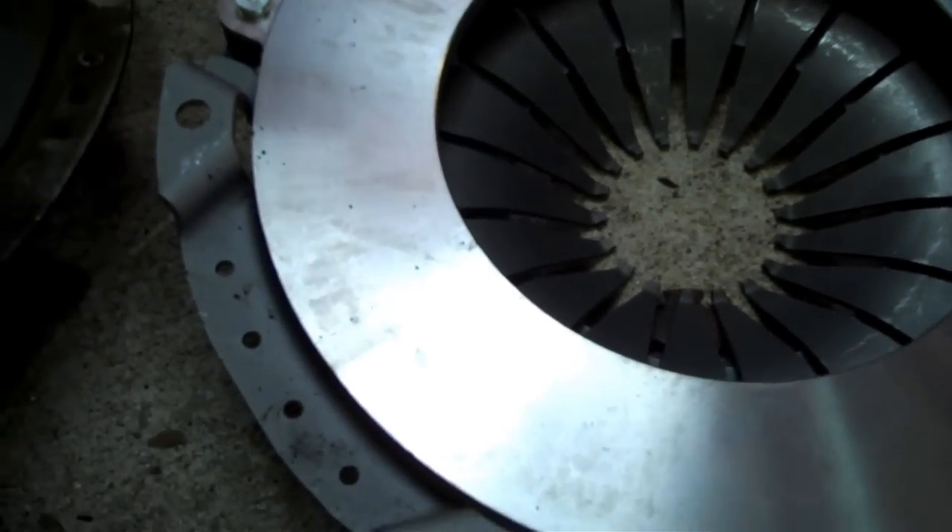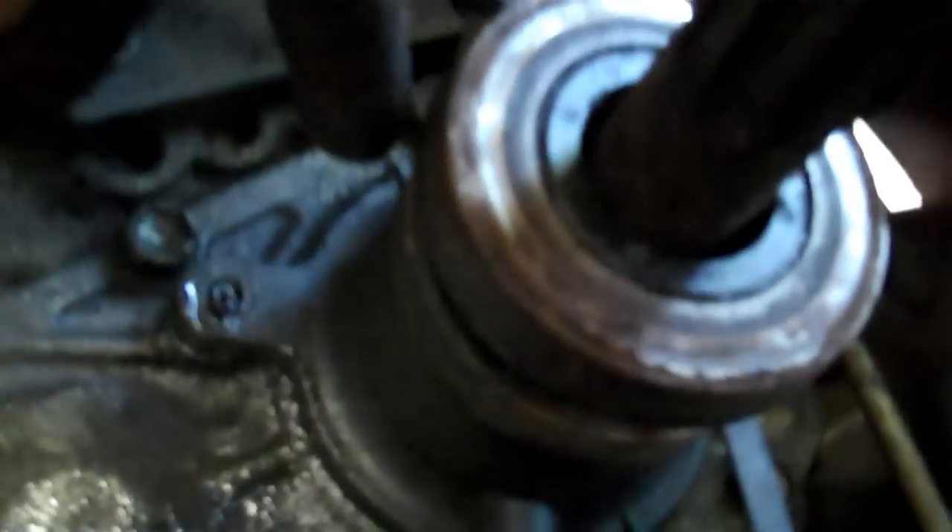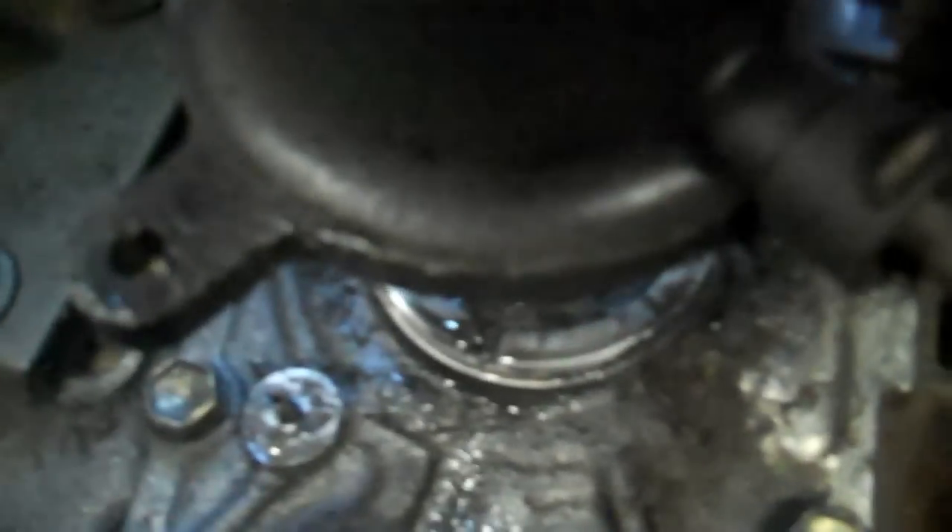That thing has been generating a lot of heat — hotter in some areas than others because of the uneven pressure of these diaphragm fingers. Now, a little ahead of myself — see this little ring right here? That was just taken off with a flat screwdriver. That's your throwout bearing. On this little pin is the only thing that holds the throwout bearing in place — it does not take a lot because it just kind of goes along for the ride. This slides right off — you gotta work the lines through here.